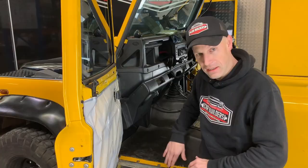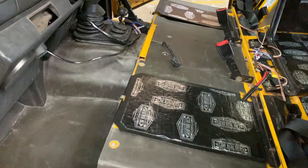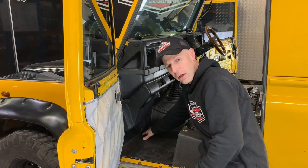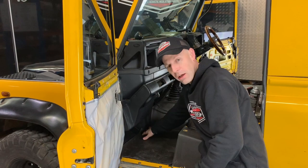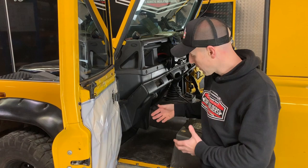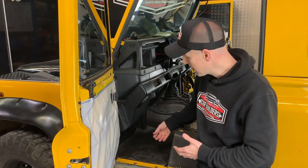Finally, if this was a passenger vehicle, usually we'd have more room to put an underlay, some foam, and then the vinyl on top. But the packaging is tight in these military-style vehicles where they just have a rubber floor mat that's moulded, so we're limited in what space we can put in. We've basically upholstered all these seat boxes with it, covered it over the transmission tunnel, and the last bit is this sheet we're going to drop in and glue down. I did mention that ideally to reduce engine noise you want to remove the dash as much as you can and go right up the firewall to that plenum or the lower screen. If you're doing a restoration job, I would recommend putting as much as you can as a firewall blanket up through there to cover out that noise. Then our factory rubber Land Rover floor mat is going to sit straight over the top of this.